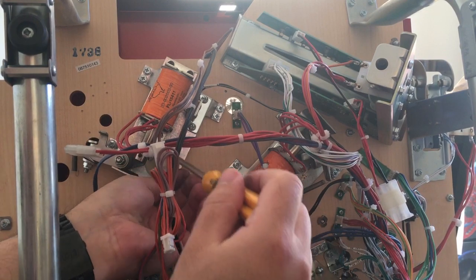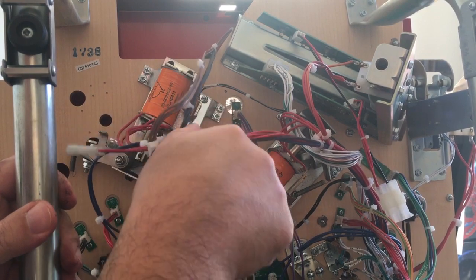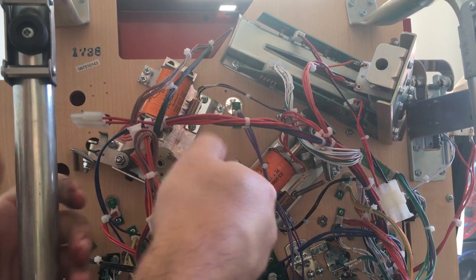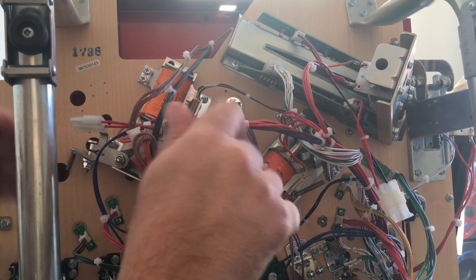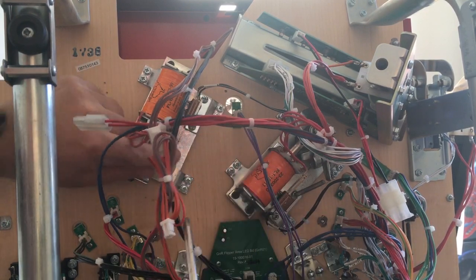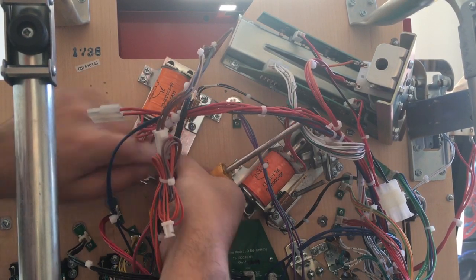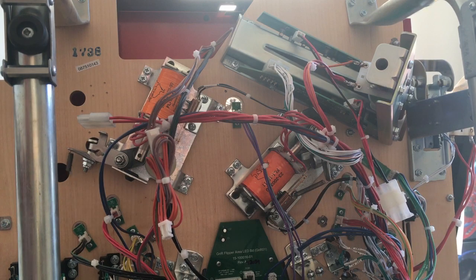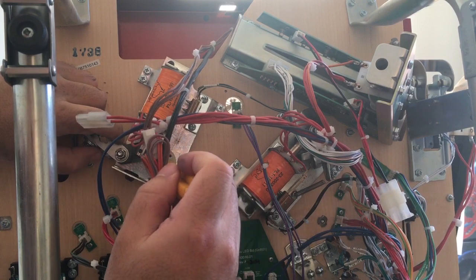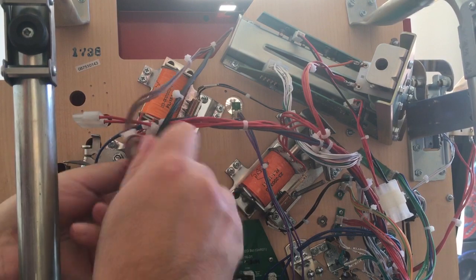So this is just genius, and I'm gonna tell you why. If you have old Bally Williams games where, when you shoot, the flippers feel a bit wobbly and you're thinking, what's going on? That was a washer in a JJP pinball machine. Yeah, wobbly flippers on your old Bally Williams machine, and you just put in a new rebuild kit, and they're just still wobbly. That's because of the bushing, guys. These plastic bushings, they will wear off.